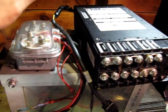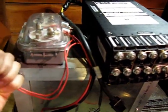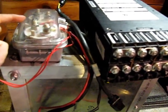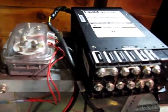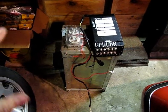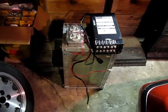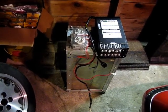So I had to have another switch for that side. When you removed power, both contactors would shut off, and no power would go back from the accessory battery. It was a whole complicated system, worked really well, put out a lot of power, but I was concerned with it getting wet and it was very loud.